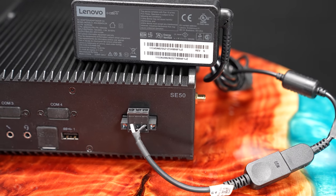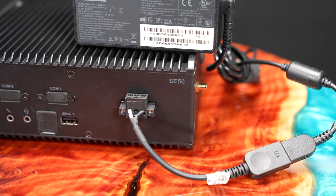In terms of power consumption, this thing was actually great. We saw generally 9 to 11 watts at idle, and our maximum power consumption was well under 25 watts for most of our testing — really reasonable for a system like this. Maintaining low power consumption in this industrial market is super important because you have to think about what happens during a power failure or how you deliver power to wherever you need it. Something that would be really interesting to me personally is if Lenovo figured out how to power this whole thing on Power over Ethernet — especially with PoE++ where you can get enough wattage to power something like this. I really think that would be cool. I didn't see it in the spec sheet, but I think Lenovo's customers would want it one day.